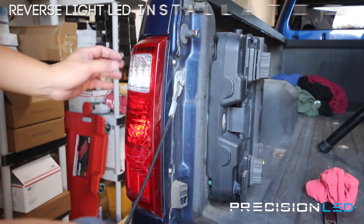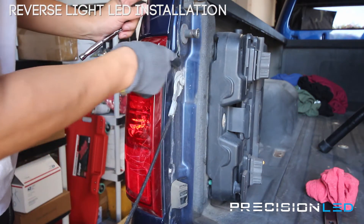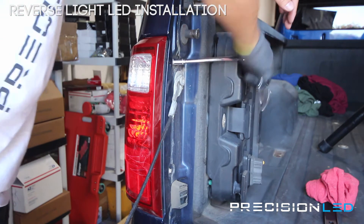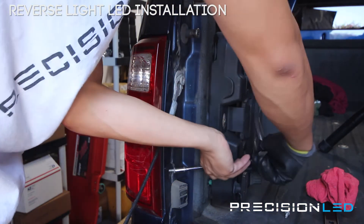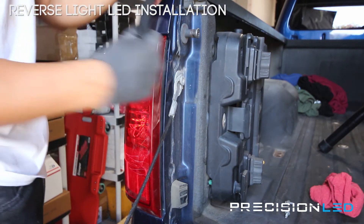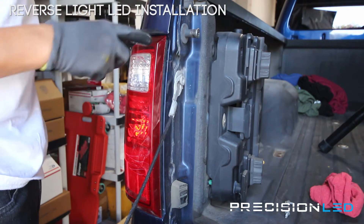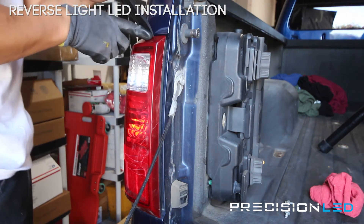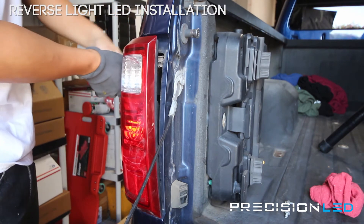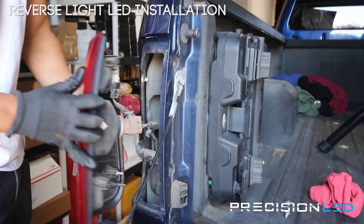We're looking now at our rear tail light where we have our reverse light. You're going to need that 8mm socket and socket wrench. There are two bolts, one here and one at the top — we're just going to start by removing them. Now that you have it off, it might be a little difficult to get this out if it's the first time it's being removed. From our kit, use the crowbar shape tool — the fat curved end. Stick it in one side and run it down the side to help release. Rock it back and forth and that pops it out from the two guiding pins holding it at the bottom. Now you can pull out.